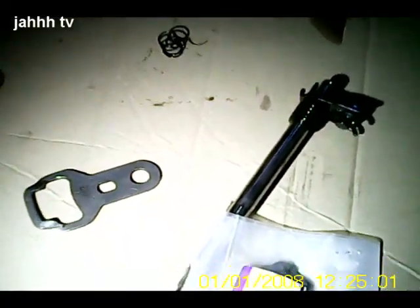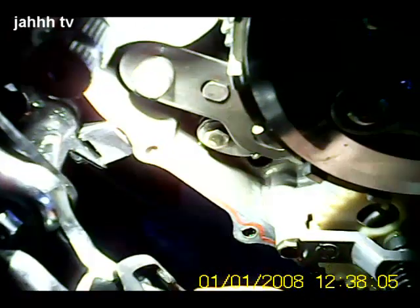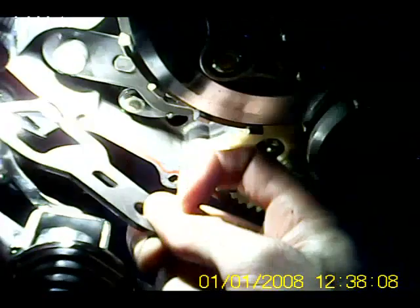Problem would appear to be solved. What you're looking at is the engine — 156 FMI. That there is the gear selector thing I've been having problems with — it's more or less an exact copy of the CG 125 engine, down to really minute details. The problem was this old shift plate — right there it's worn, and it kept jumping off. I can finally see why now. Just a shitty little bit of metal could have done that on just one bad gear change, and that's it — it's constant.